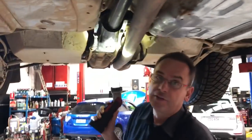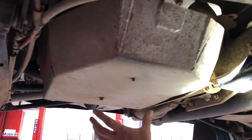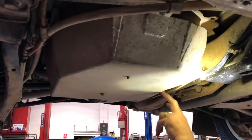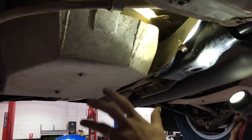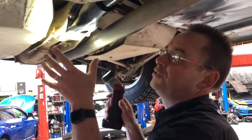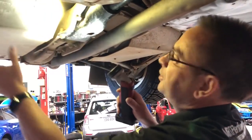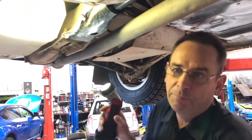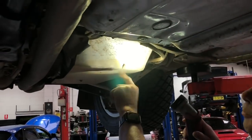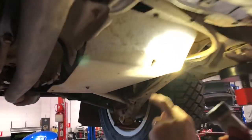Down the back, this is some of the stuff that you don't normally see. All the underbody protection continues down here from the body, but this part here is the aluminium protection for the fuel tank. Running the car as set up, it doesn't have an FIA bladder tank — it still runs the original factory fitted fuel tank, and these guards on either side are designed to protect it from impact damage. You can see the thickness of the aluminium and just what it takes to puncture it — if that was a fuel tank, he would have had a hole in his petrol tank with that type of damage. That's the type of thing we'll be checking for when we remove these underguards.